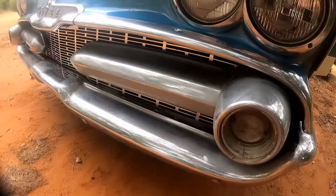That old boy didn't take it apart like we did, I guess. And then we went the extra mile on this one, that's for sure. We took it completely apart — we had the doors off of it, the hood, the trunk lid, everything. I think our left to right is actually pretty good on here, but I was noticing the up and down. If you notice, we're kind of tight over here on this side, and then over here it appears to be a little bit loose. We've got a little bit of a gap there. So what I've done is I've just gone through and tightened the bolts up just barely enough that if we were to move it, it would stay wherever we move it, and then we could tighten it up.